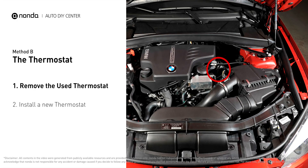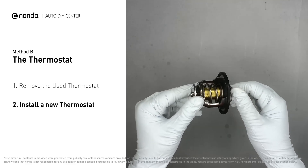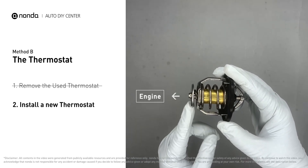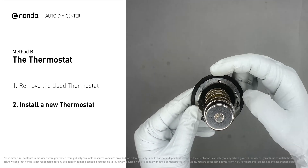In most cars, the thermostat is placed near the water pump on the cylinder head. First, carefully remove the thermostat from the engine — the engine has to be cooled before attempting this process — and then install a new thermostat. To install it correctly, make sure the short end goes toward the hose and the deep end goes towards the engine. When you install it back, make sure the jiggle valve is pointed straight up to the top of the engine so the air can get through the system.